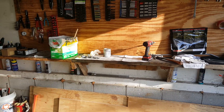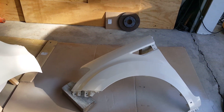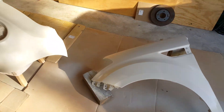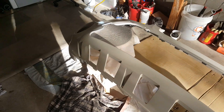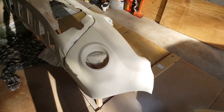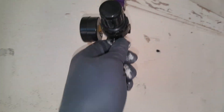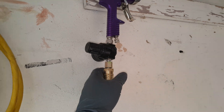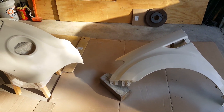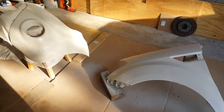I wound up getting a pint of base coat and went over these again, and they actually matched the color a little bit better. I've got a little piece I cut out of the bumper that I used for a color match and tested it. This is looking way better than the original can for sure. I got a Harbor Freight spray gun with a built-in regulator — this has been working pretty good. I got a couple more base coats down and I'm going to wait about 45 minutes before putting clear coat on. That will give me time to clean the gun out.